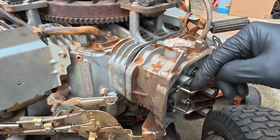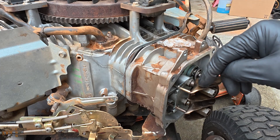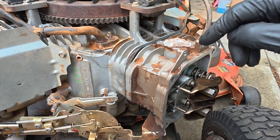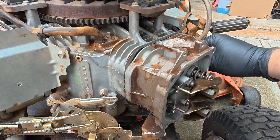So after the intake opens and starts to close, right as it closes, it's going to start compressing those gases, which means we are at the compression stroke, and then we just need to get it to top dead center of that stroke. I'm going to put my finger over the spark plug hole and watch the rockers.